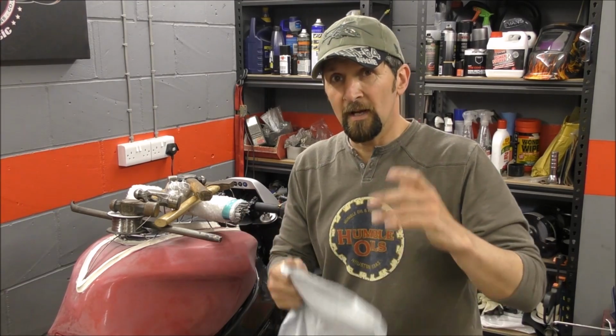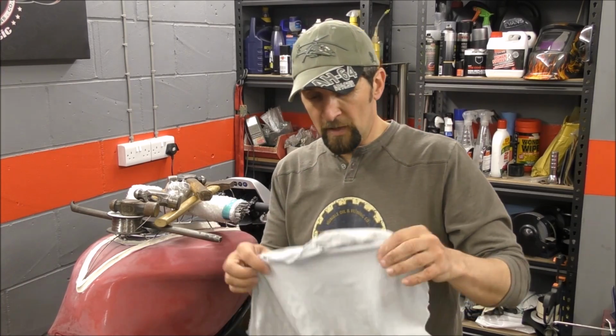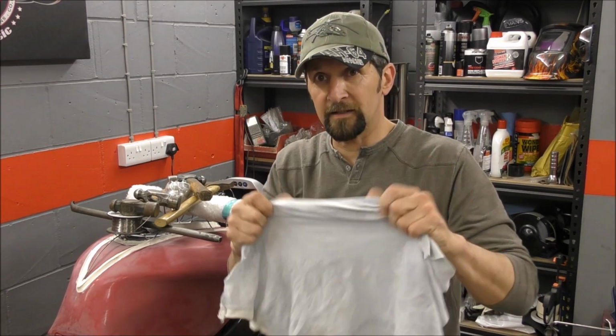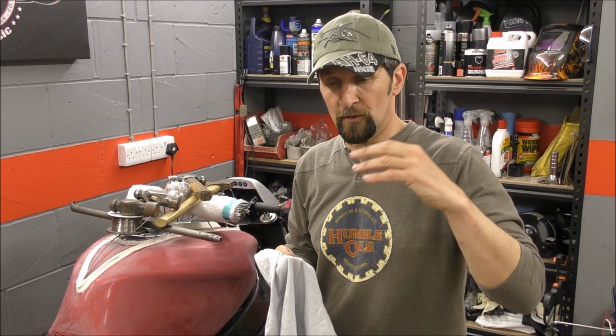What I'm going to use is, those of you who followed the build on the back end, I did it on that with the seat unit that I built, and I'll be doing it on this seat unit as well. You stretch cloth over it, you super glue the cloth to the frame where it touches, and you get a drum skin effect, just one layer. You then soak that in resin, it becomes like a cotton fibre resin layer. It's flexible, you know, it's not completely strong.